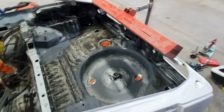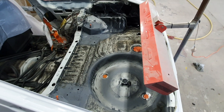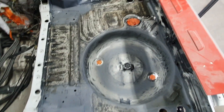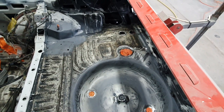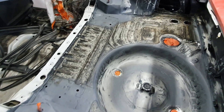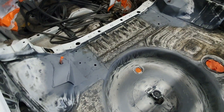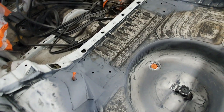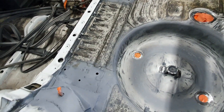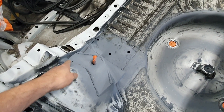I've got the heater in here just drying it out and warming up the panels before I spray some etch over the bare bits of steel. Then I'm going to spray what you'd normally use on the sills — a rubber sort of coating — just to make it all nice and uniform, since it's not that pretty in here. I'm also going to get some urethane and tidy out some of the edges where the sound deadening is, and some of these pits and holes from where it's been welded in on both sides.